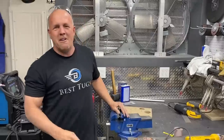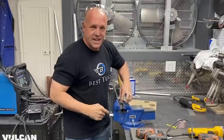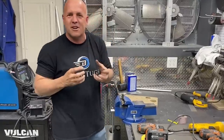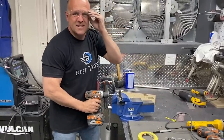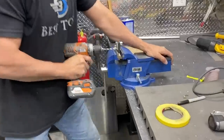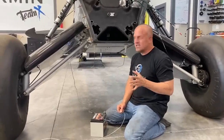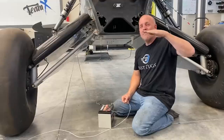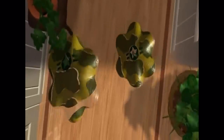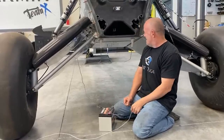All right guys, I'm down to the final couple brackets to stick my cowl flap bomb bay door on the bottom of Scrappy. I got some carbon plates I made for spacers — I needed quarter inch spacers and didn't want to stack washers, carbon fiber seemed good. I'm just drilling out the last of the two brackets and we'll get it mounted up. With my two-day project — it was just two partial days. Yesterday we made, cut out, built my flap, cowl flap slash flap slash bomb bay door drop. We designed it, made it, painted it, got it ready, and installed it today. I'm going to try it right now — it's running off a linear actuator. Silly things like this make me really happy.